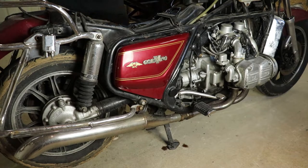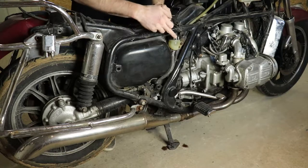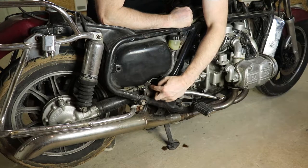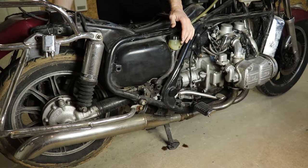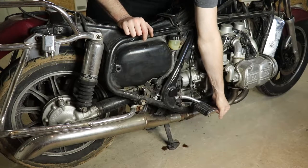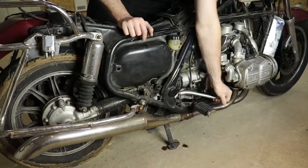If I come over from the opposite side I can pop this side cover off. Right here we have a rear brake fluid reservoir — the master cylinder is down here. We have a line that comes off the master cylinder, comes up around the wheel well and back over to this side where the rear brakes are. As you can see the brake pedal is still really stiff. I just gave it a couple of shots of WD-40 in an attempt to help free it up, but it's still really sticky to the point where the spring won't even return it.